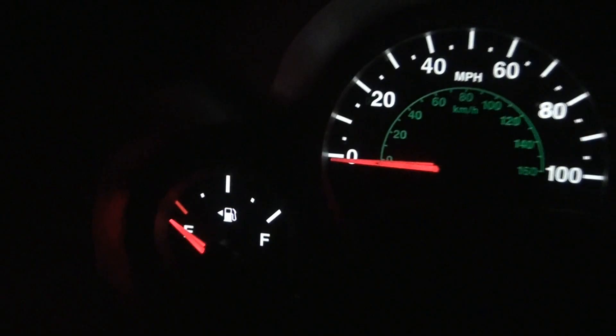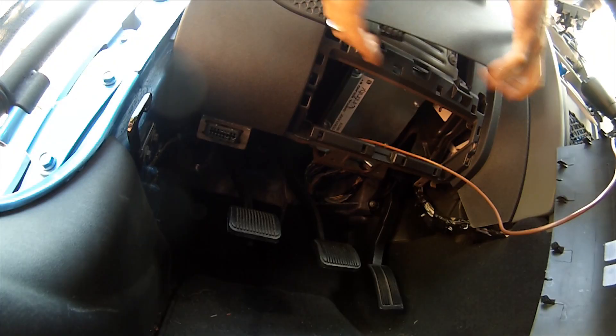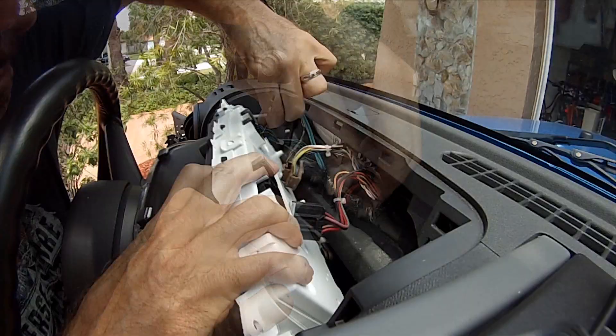In the case of my Jeep, I had a panel below where I put my garage door opener hack, and another panel right above that — they just popped out. Then using a socket screwdriver, I removed two screws that held a trim panel in. Then four screws held the dashboard cluster in place. When that was free, there were three wiring harnesses I had to pop out, and my dashboard cluster was set free. And off to the shop we go.